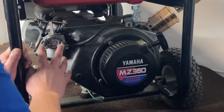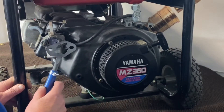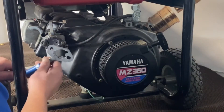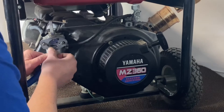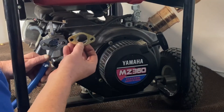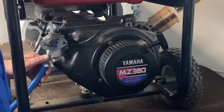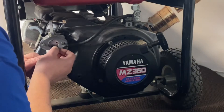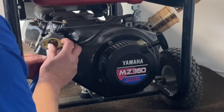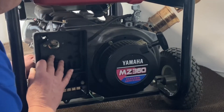Now that we've got that removed and we've exposed our gasoline carburetor, we're going to go ahead and install our slim adapter on here. Use the existing gasket that's here. Go ahead and slide the adapter on, and then the metal plate that went between the air cleaner on the inside — we're going to install that on this side. There's already a gasket on the back side of this.